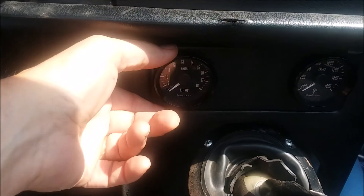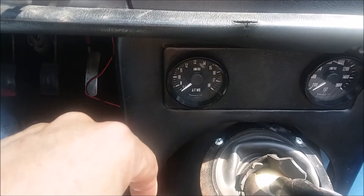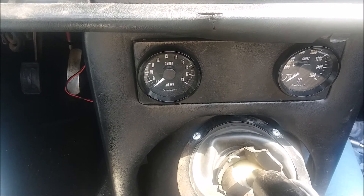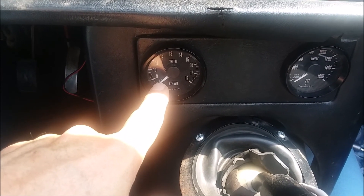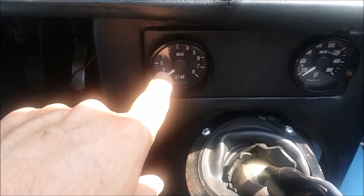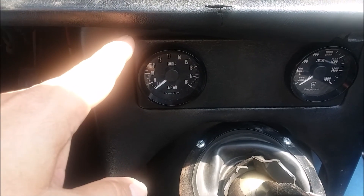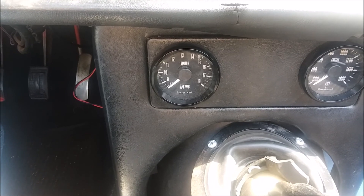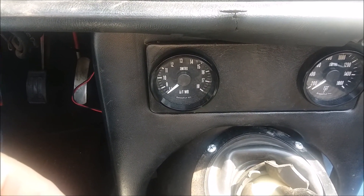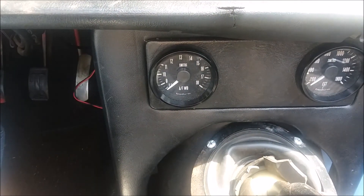Something I might do differently is angle these gauges up a little bit so I can see them while I'm driving. This part of the gauge is hard to read while driving - I shouldn't be reading it that closely anyway - and the data logger will help with all that. This channel is about things I'm doing and learning that are not in the manual. One thing I'm learning already - I'll show it in a later video - is that I get a pause on acceleration. I thought it was leaning out and I needed more damping, but actually the needle goes the other way and it goes too rich. So I need a lighter oil to get rid of that hesitation. If you enjoyed this video, please comment, like, and subscribe - it encourages me to do other videos like this. Stay tuned for another video where we'll actually use the gauge and diagnose different needles.